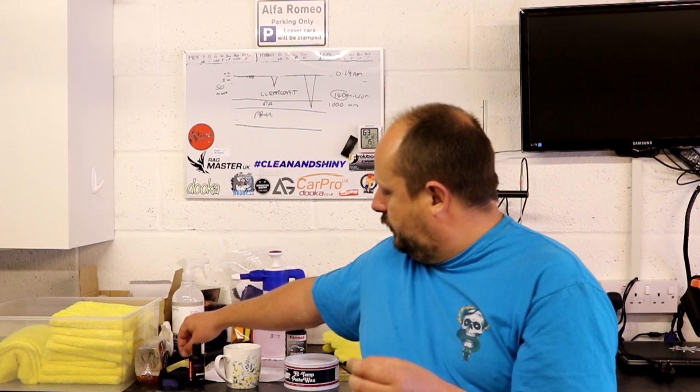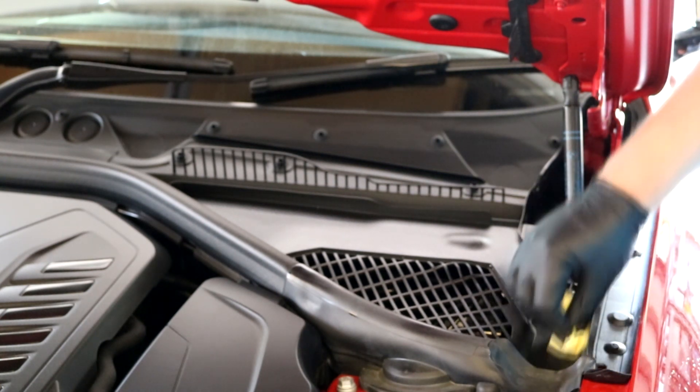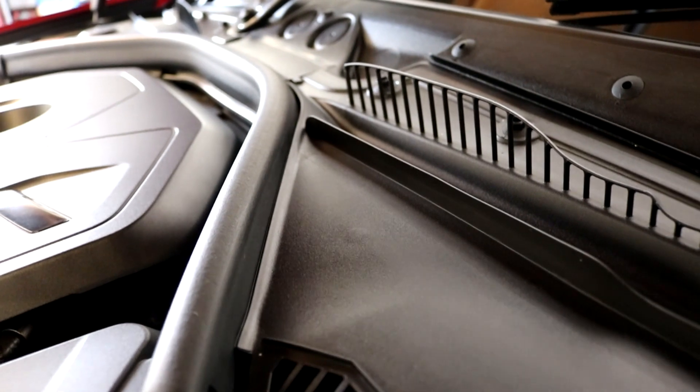You've got to be very careful with dirt and grease in the engine bay — even after cleaning very thoroughly, we were still getting some traces of dirt coming off over the applicator. That's a bit of a faux pas, but you're going to get that a little bit especially on older cars. My car's relatively new; if you're trying to dress an older car you might need to spend longer cleaning and degreasing. The short answer is it's very easy to apply. I found that more was more — it was actually better to get a fair amount of product all over the plastics you're treating. I didn't use it on rubber — it says it's for plastics and vinyl, so that's what I used it on.